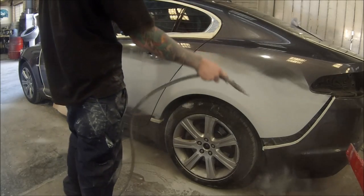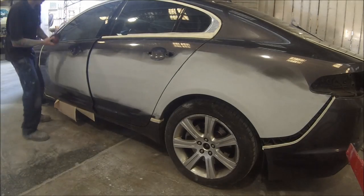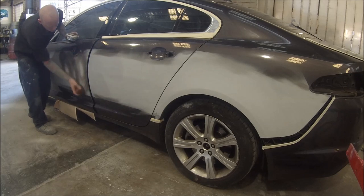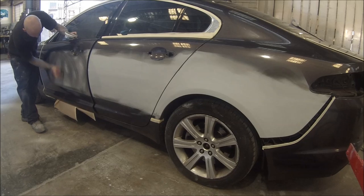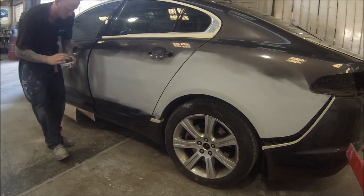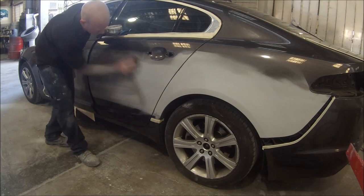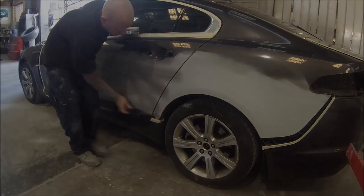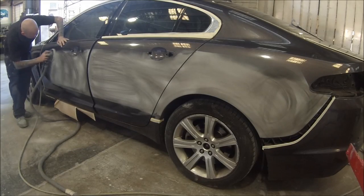I've guide coated it before I did that. Now when you're dry sanding, just keep it clean — that's the best advice. Do one set of sanding, blow it off. Next up I'm going to be using 320 to get rid of the 180 scratches, using the guide coat. The first time I used the guide coat we were using it to find highs and lows; this time we're using it so that those 180 scratches will show up when we're using the 320 grit.